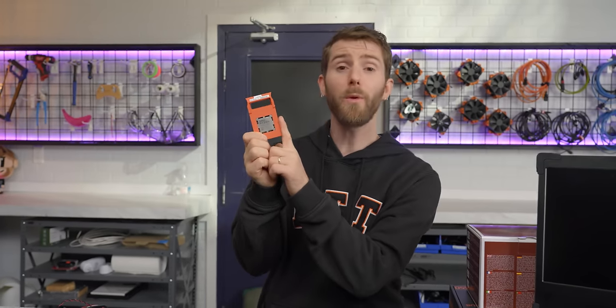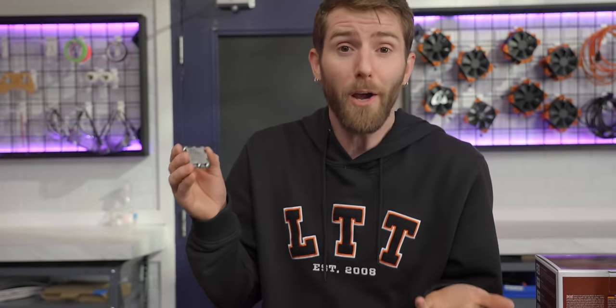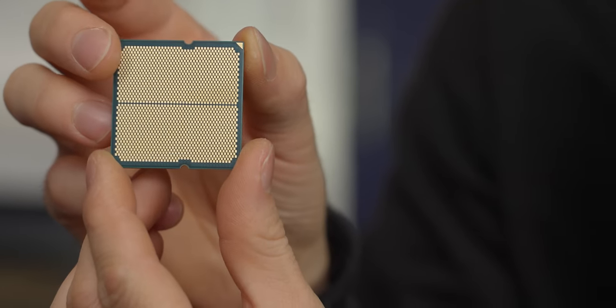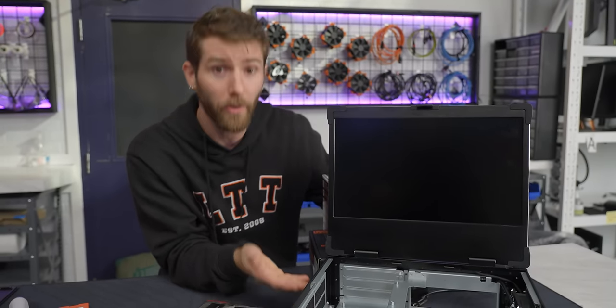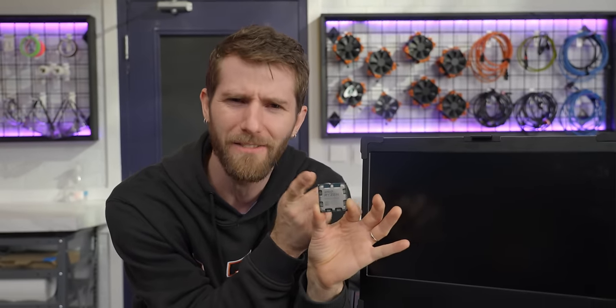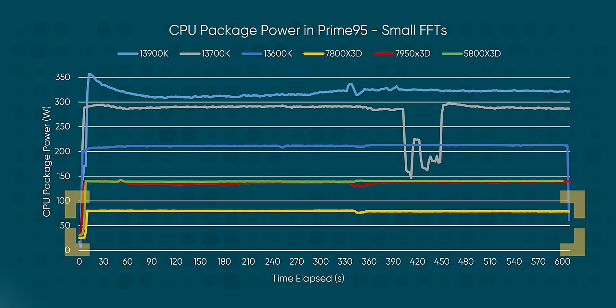Kicking off the build with our CPU, we've gone with the Ryzen 7 7800X3D. What's remarkable about this choice is how unremarkable it is — I recommend this thing all the time, and that's what makes a solution like this so appealing. It's technically a 120-watt chip, but AMD tends to baby these 3D V-Cache chips pretty hard, keeping voltages so low for better reliability that real-world power draw is rarely more than 80 watts depending on the cooler.